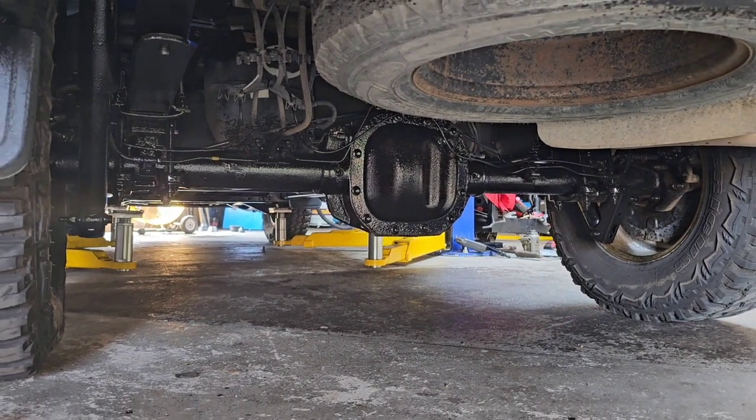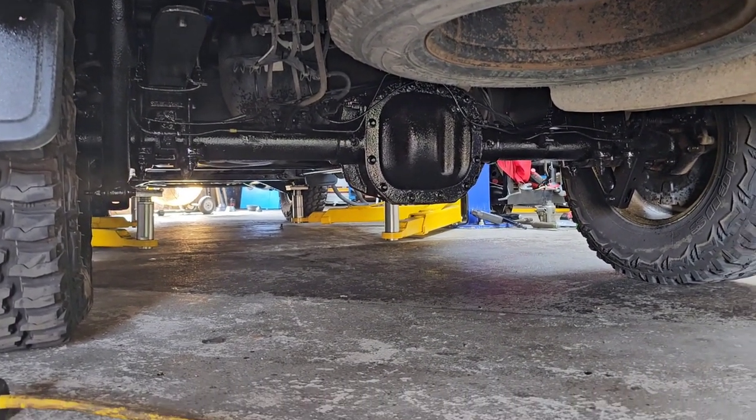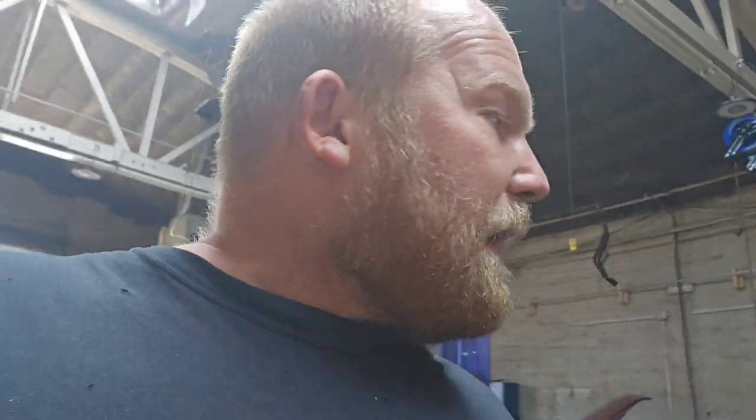And we are finally finished. I forgot to tell you — the fluid film to do the whole bottom of this truck pretty heavy like we did was eight cans. It took two guys about 40 minutes to do it, really heavy. And it cost about 60-70 bucks on Amazon for a case of eight. It is not really that stinky — a little smell to it, but not much. I had a mess all over my face, oil on my hands and everything. It's messy stuff, so be prepared to wash up right away. I'd lay some cardboard on the floor. That's the fluid film.